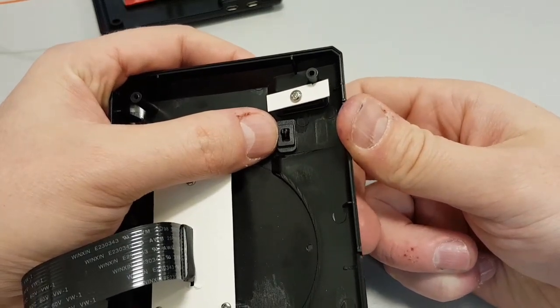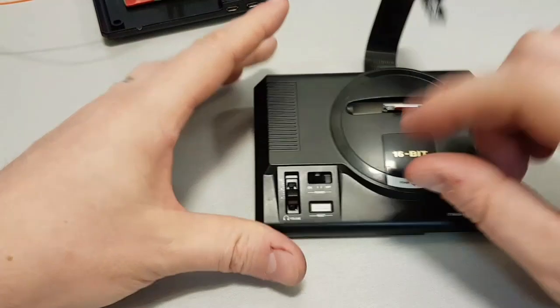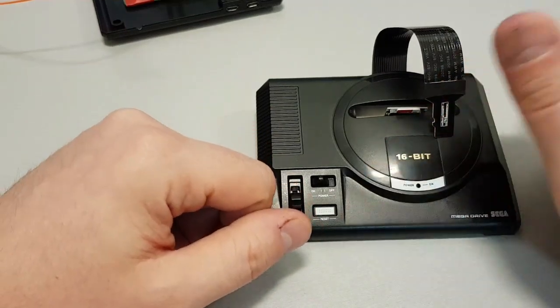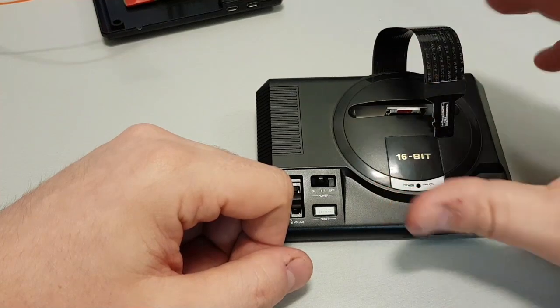So what I didn't want to do was put in two switches, click on, click off, because the way the Raspberry Pi works is that it's a momentary switch. So it's just connecting a circuit. And when it sees that, it can't be like a permanent switch like you would have for a light or something where it's like on or off. It's always on, off, on, off, on, off.